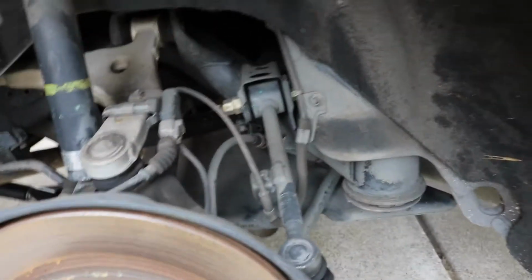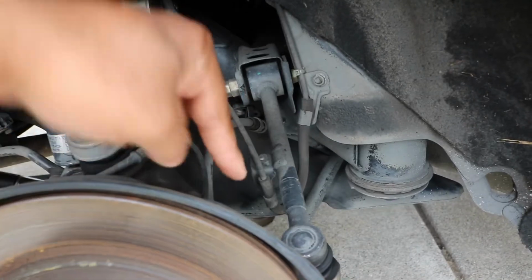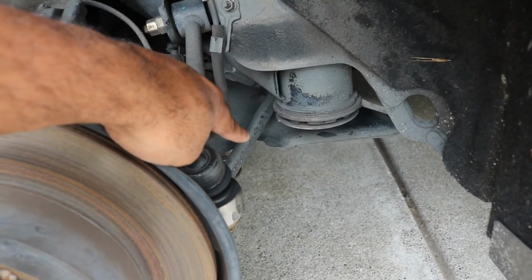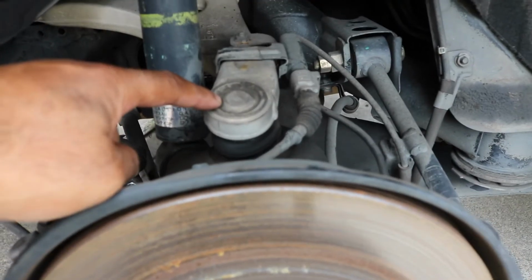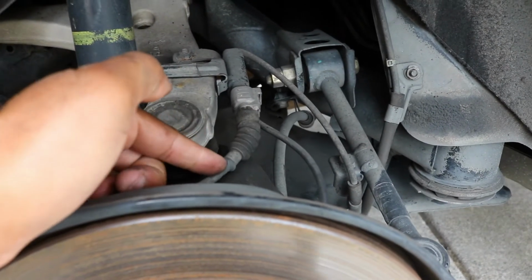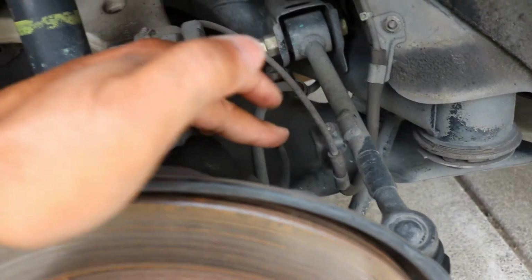That requires disconnecting a lot of things. So this here arm is gonna have to get disconnected. Obviously not up here. I'm going to disconnect it from here where this ball joint is. There's another arm that's right here underneath it. You can see that goes to the bottom there. I'm going to disconnect this upper control arm. I'm going to disconnect this brake wear sensor. I'm going to disconnect the speed sensor right here for the ABS.